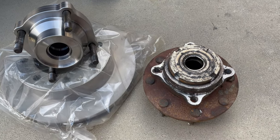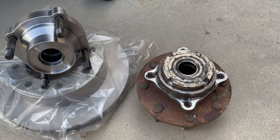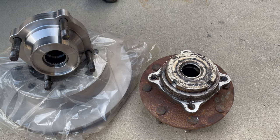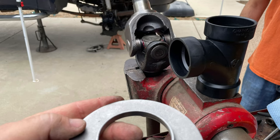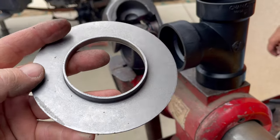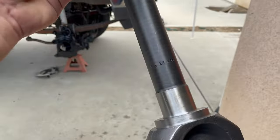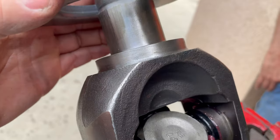Transfer the u-joints over to your new spindle set. What that means is there's going to be a lot of cussing and swearing — it's just a very difficult job. What you might want to do is just get some new ones; it might save you some heartache. Now, this is a mudslinger that comes with the Dodge kit. If you get the Ford kit you won't get this one. I didn't read the instructions and thought I needed it, so I went ahead and ordered it, but I'm not going to use it. It would go on here and you would pound it down onto this surface.